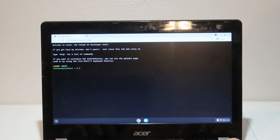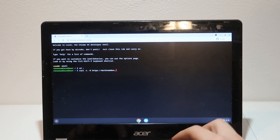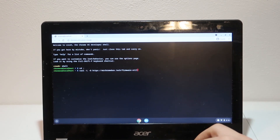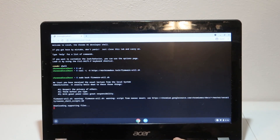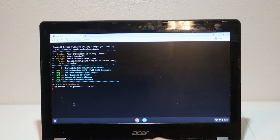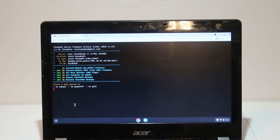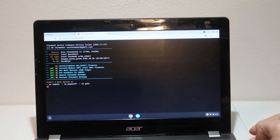We are now in the Chrome OS shell. From here, we need to cd into there, and now we can type: curl -L -O https://mrchromebox.tech/firmware-util.sh. Now that we've done that, we can just go ahead and run: sudo bash firmware-util.sh, and press Enter. As long as it works, we should see it downloading supporting files. If you get an error, just restart your Chromebook and it should fix it. We're going to go ahead and press option 2 because that will install/update our full ROM firmware.